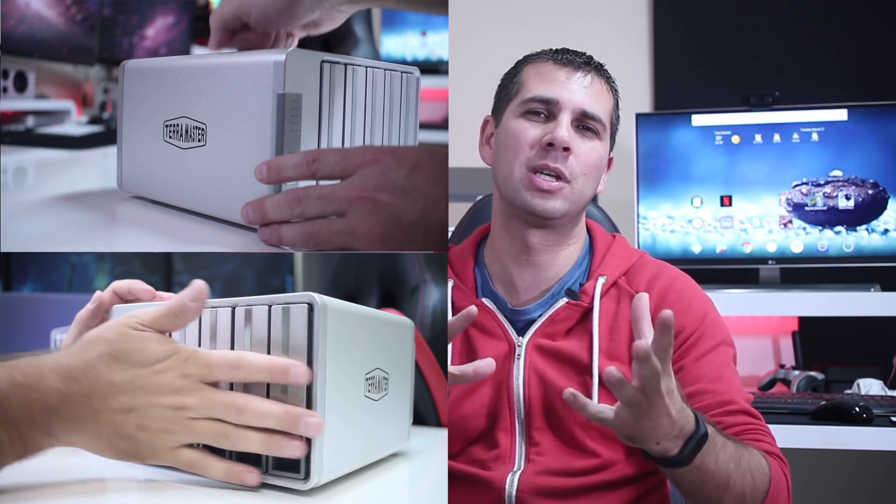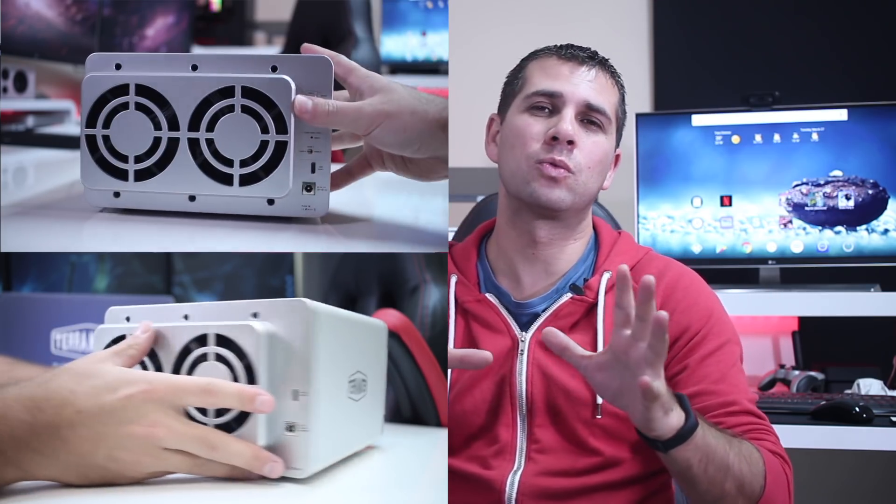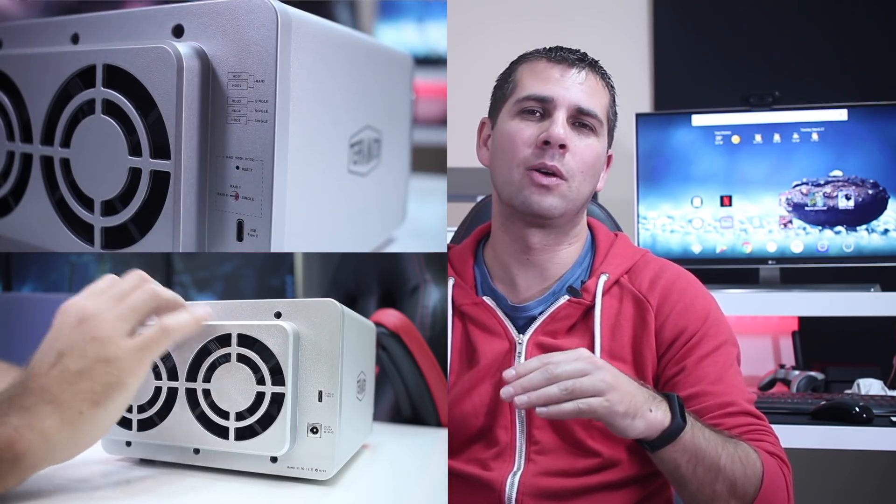And we are back. For those of you that want to know right out of the bat what the differences are between the D5300 and the D5300C: if you want to check out the D5300 review I will leave a link down below. When we look at them on the outside there's no difference. On the inside there is a major difference — the D5300 only works with software RAID, while the D5300C works with hardware RAID on the first two discs, and then the three last discs are used as single discs. This is the main difference between these two models.